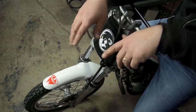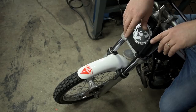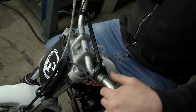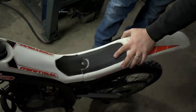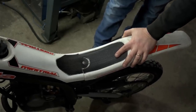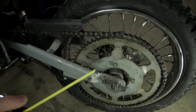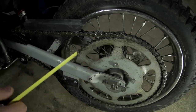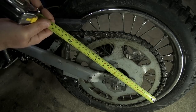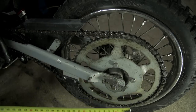It looks like it's done a lot more street riding than trial biking. The tires are absolutely cooked — they were overinflated, almost as hard as a rock. These are supposed to be really soft knobbies. I'm guessing the kid who had this before did a lot of trying to keep up with his motocross friends. It does have a squeak somewhere in the rear suspension, maybe the swing arm — that's next on my list. I'm hoping it's something cheap like a plastic bushing. Trial bikes don't go as fast as motocross or enduro bikes — they're not meant to. Check out the size of the sprocket on the back: that's like an 11-inch sprocket on a 14-inch tire. They're meant to go very slowly — or they can go fast, but they're designed for slow climbing to get up over and around obstacles. Lots of low-end power.